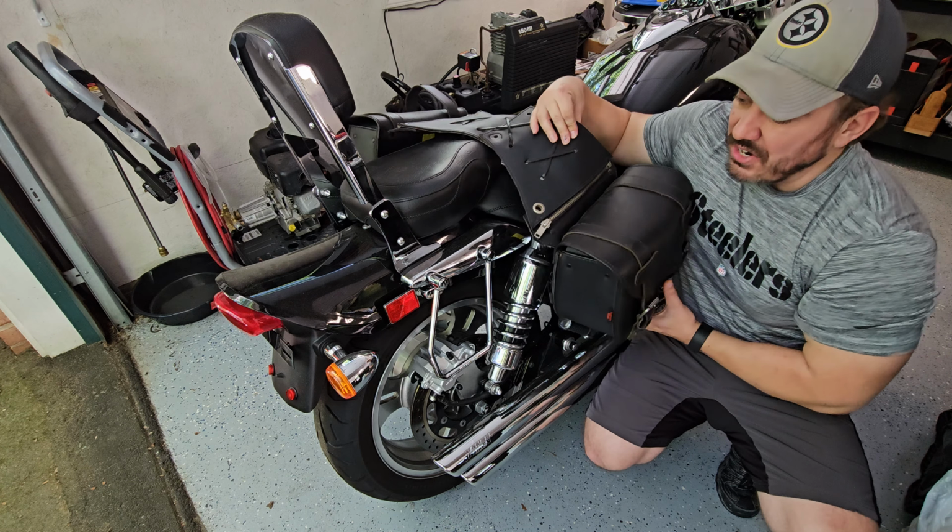All right, after devising a plan, here's what I ended up coming up with. I got all of this off of Amazon, starting with these insulated hose clamps. So these right here have rubber insulation, so when they go around the saddlebag mounts, it will not scratch or mar the chrome. So these are perfect. Now my saddlebag mounts are roughly 1/2 inch in diameter, so these 13 millimeter hose clamps will do just the job. And this set came with 5 of them. I got an assortment set. You can also get this at like Harbor Freight and such, but these will come in handy later.